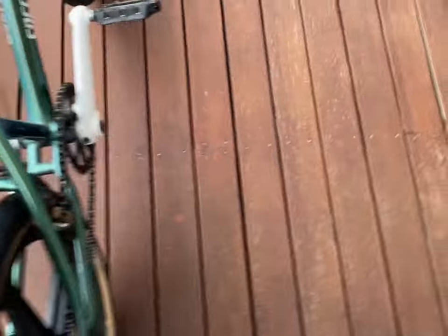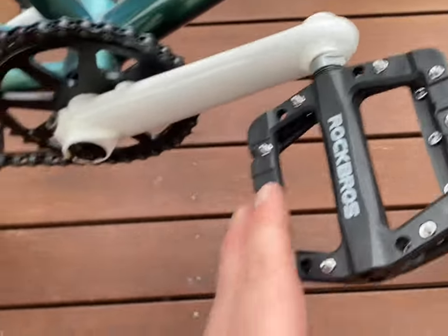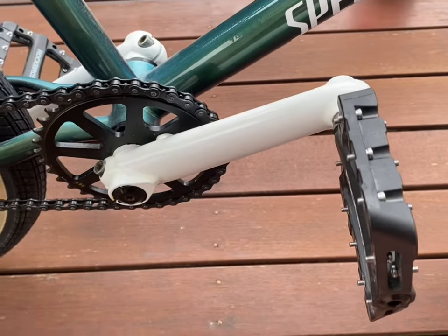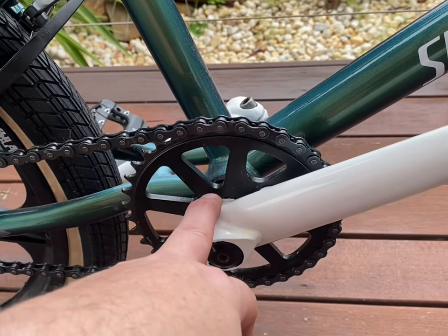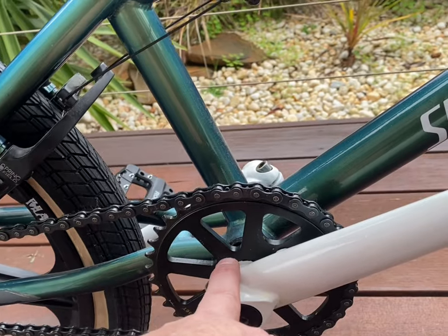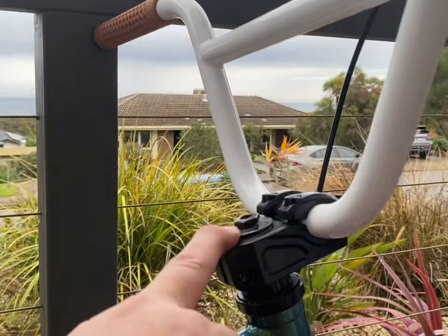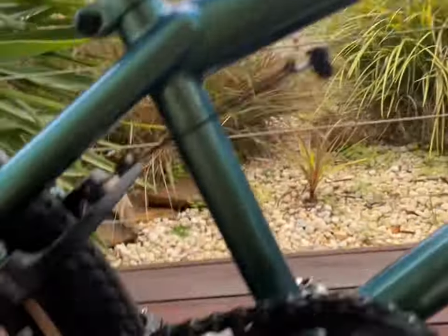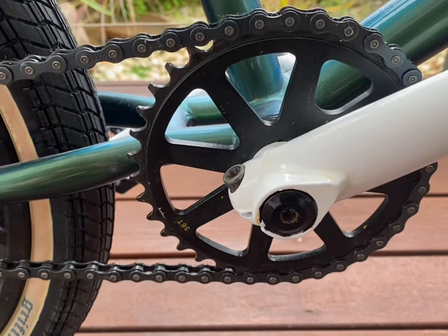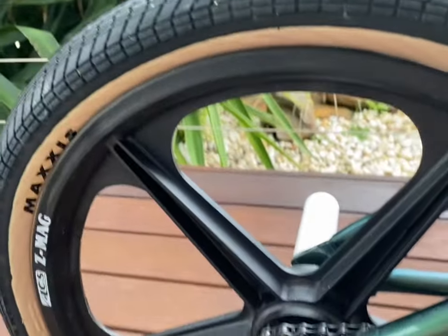Brand new pedals - Rock Brothers pedals, which are a mountain biking BMX generic style pedal. New crank bearings as well - new bearings in the bottom bracket. Also got new bearings in the head stem and a new headset too, though I had to use the old bolt in there, so I just quickly put some black paint on that to make it look a little neater. It's the original 36-tooth cog on there, plus a brand new cog on the back to fit the ACS rims.